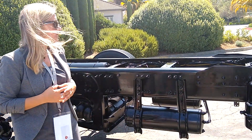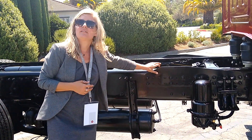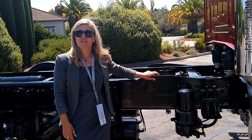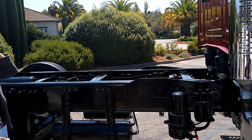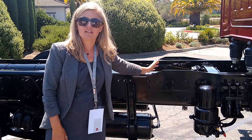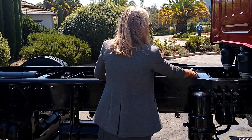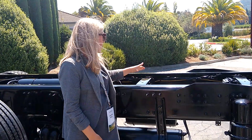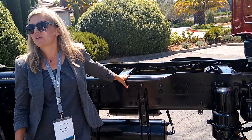This unit is set up to be a cement mixer — a bridge law mixer with a lift axle. They will almost always have a transition plate. About 10 or 15 years ago without this plate, frame rails would crack right behind the back of the cab because of all the force the mixer puts at the back cab crossmember location. We install these as an option for everyone to reinforce the frame and help the bodybuilder install it. Also critical: there's nothing located in this section — that's where the pump mounts. If there were air tanks, air dryer, or crossmember there, the bodybuilder would have to relocate all those components before starting work, which drives time, cost, and expense.